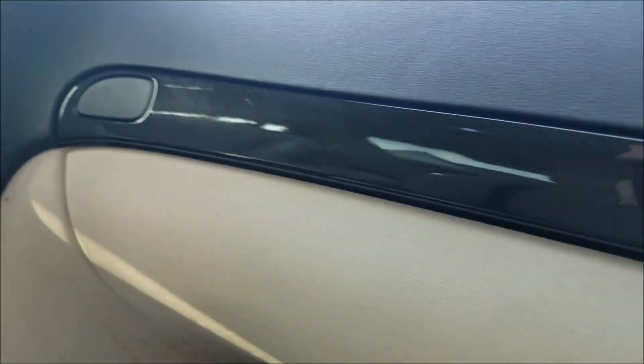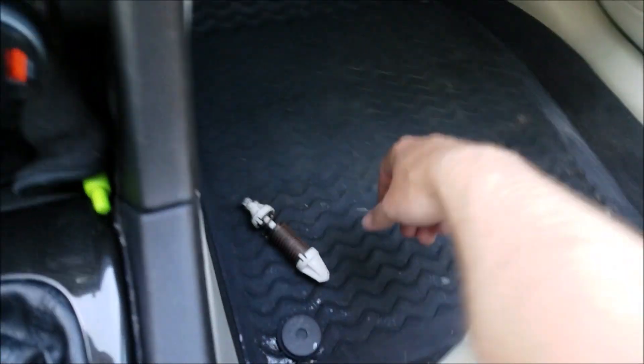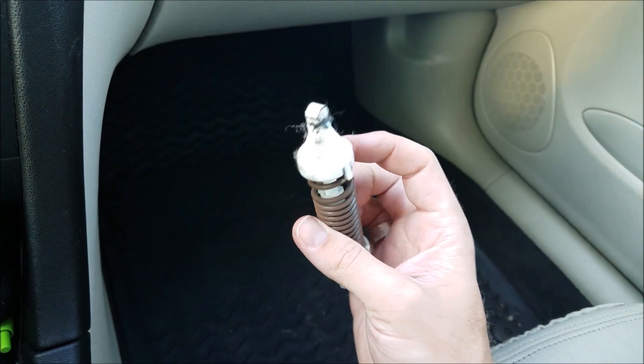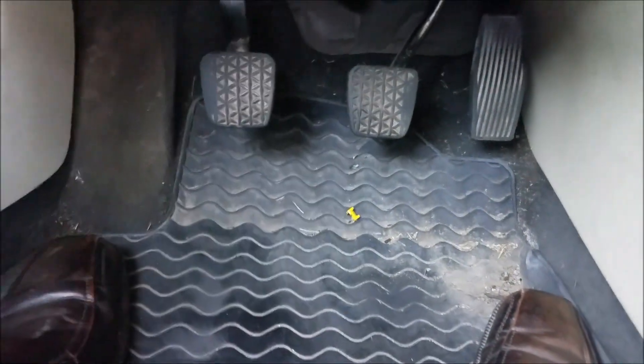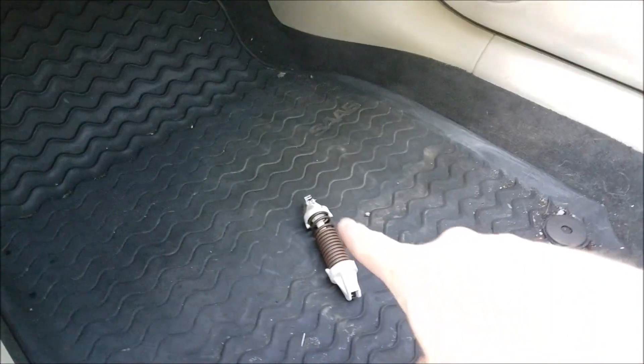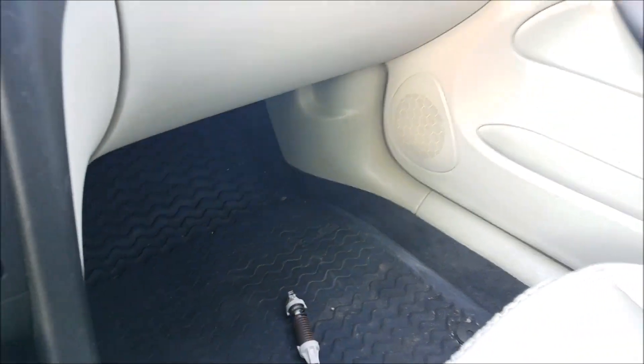Look at that — looking good. Just need to clean that and clean this guy there and it'll be a perfect match. So here is the final product — well, not my haircut, but the car. There it is, nice and squeaky clean. Even got this gross crusted pop off of there. And conveniently, as soon as I got this done, my clutch spring — the little yellow clip on the end — broke, so that's pretty awesome. Now my clutch pedal is probably four times as hard as it should be. But that's actually a simple fix that I've done before on my black 07 Saab, the 60th Anniversary 9-3. If you're curious about that repair, just click up there.